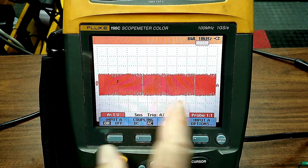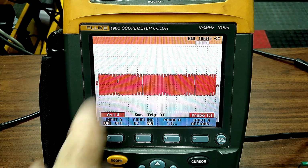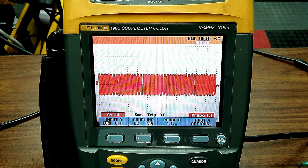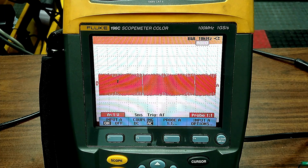Okay. So right there's number one, right there's number one. But let's say you weren't looking for number one, or you had multiple holes, and it's a multiple-tooth sensor that is going to give you a couple of different spaces where the crankshaft, on these new ones, has more than one spot to actually initiate off. In other words, more than top dead center on one cylinder. If you see a space like this, that means you've got a dropout. And you could do this on a fuel injector or any other type of actuator or sensor out there.